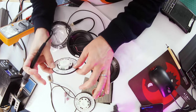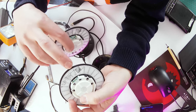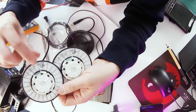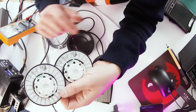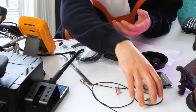On the latest drivers they've got a zero and a one marked on there — one is positive, zero is negative. On the other driver zero and one may be the other way around; it's totally random which way around they are. Take note of that because if you get positive and negative confused when you solder back together it's going to sound weird — you'd have to do a phase test.